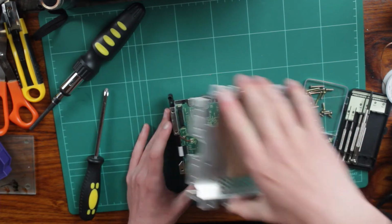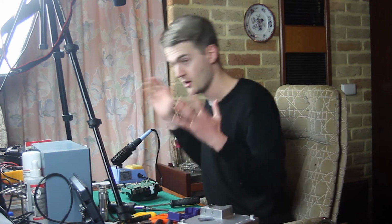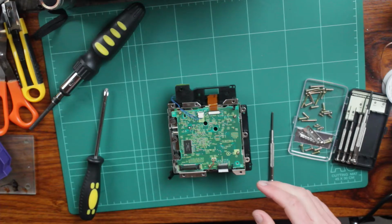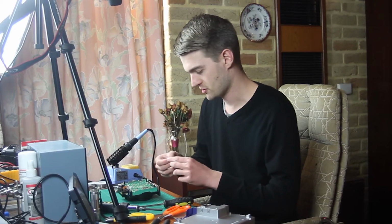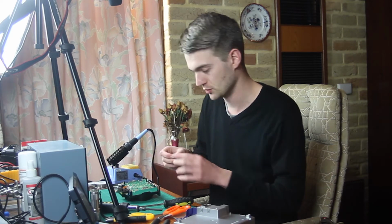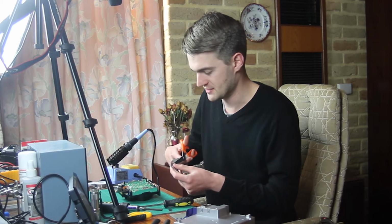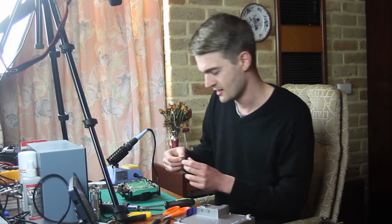So that should just come right off, and voila, we have made it to the bottom circuit board where we are actually going to be soldering this mod chip to. In the description box, I will link a very helpful PDF on how to install these things. As far as mod chips go, it's very easy. All you need is a soldering iron and a bit of solder. You don't even need to use wires.